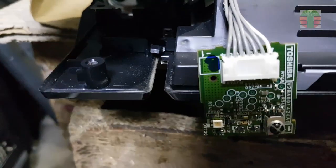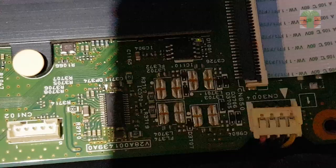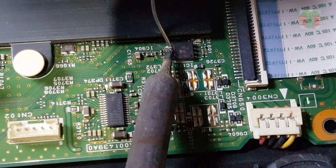Some of this trouble is usually the main board being the problem. But I don't have this kind of motherboard to replace it. It can also fix the problem by reprogramming the EEPROM. I will desolder the EEPROM and solder it to my EEPROM programmer.